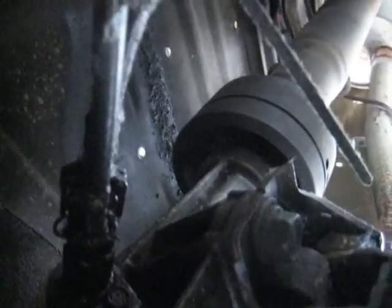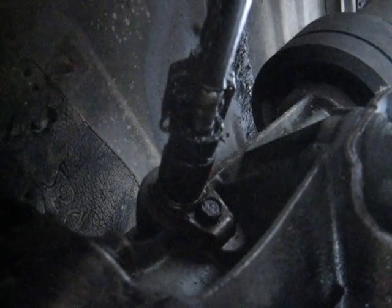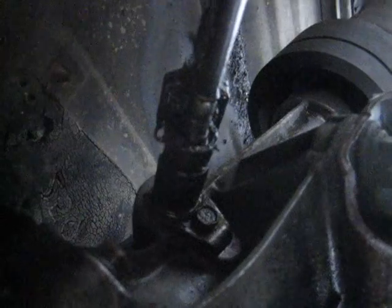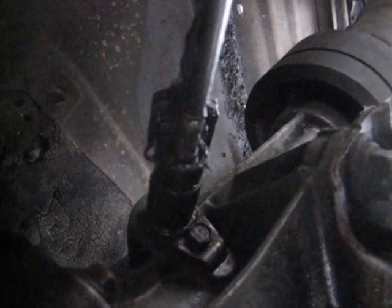This back here is new to 89. That little sucker right there is the vehicle speed sensor. In conjunction with the sensor on the rear axle, it tells the brake computer how much pressure to apply in an emergency stop because this vehicle has rear ABS.